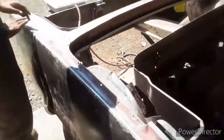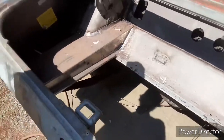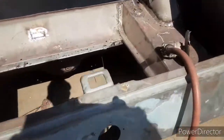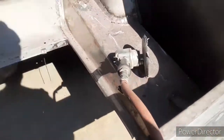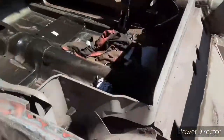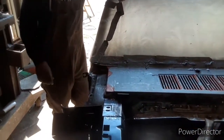So you did that in here, so that doesn't look bad. It'll all be covered. Sanding should cut everything. That's how you get proper paint adhesion. So that's what he's doing. He's getting everything blocked down, leveled, kind of fixing this mess back here. He's trying to get a nice rough surface. We have to be perfect on the outside. We're working from the top down, and as soon as we get the top sanded, then we're going to pick it back up in the air again.